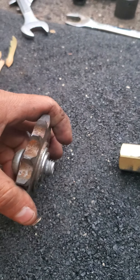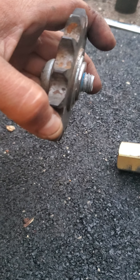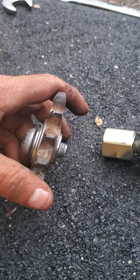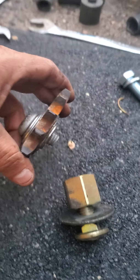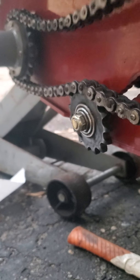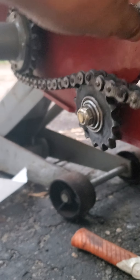When you put the sprocket, it goes up and down — the chain goes above. When you raise it, the chains get tight. But after shaking many times it goes down and the chain is loose all the time, so every two or three days you need to tighten the chain or you might break it. I was doing aeration and it fell off — I found it sitting in the middle of the yard. The machine will still run because it has its own hydraulic chain, but the tines won't be that powerful, and eventually they're gonna break.